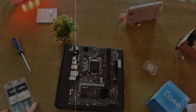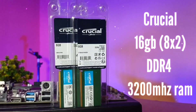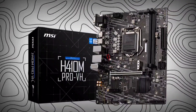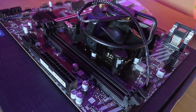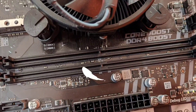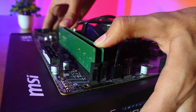After installing the processor, we move on to the RAM. I'm going to use the Crucial 16GB DDR4 3200MHz RAM — 16GB would be more than enough for my daily tasks. To install it, identify the RAM slots on the motherboard and unlock them with your fingers. Then check the position of the notch on the RAM, align it with the corresponding slot on the motherboard, and push down firmly until the RAM clicks into place. Repeat the same procedure with the other stick and the RAM is installed.